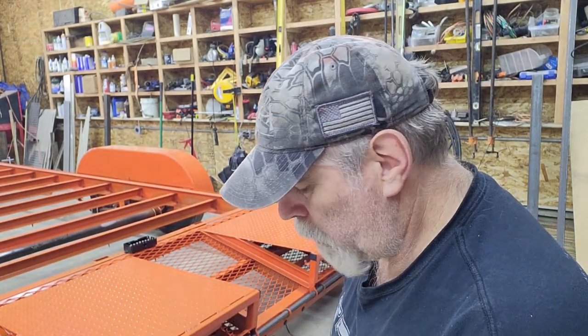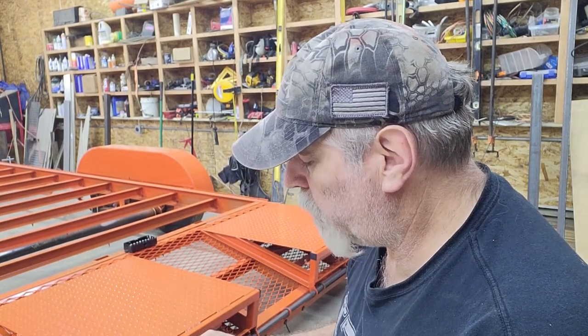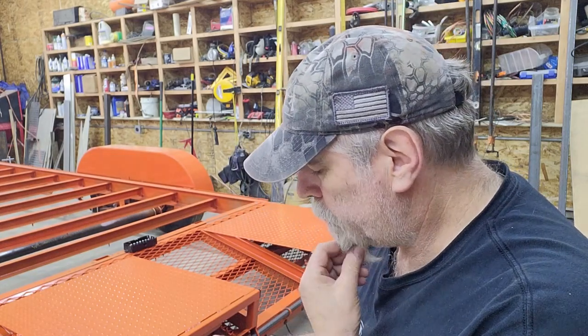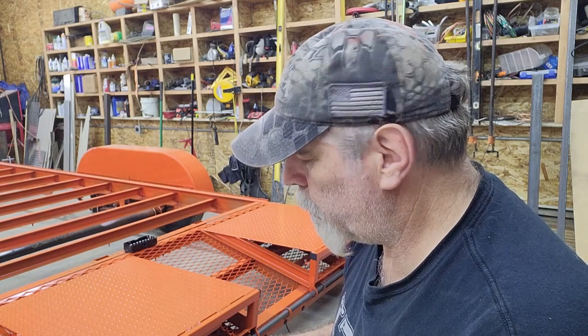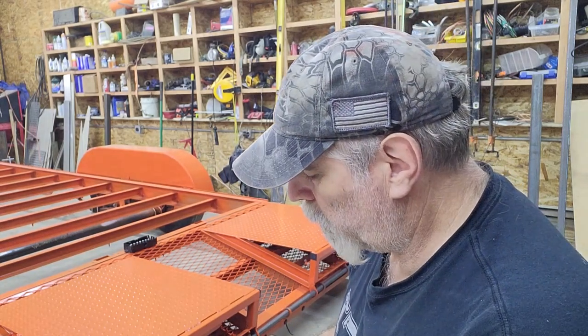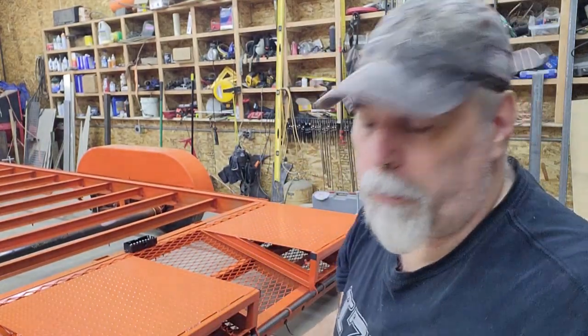So at any rate, for this trailer, it's going to be the traditional white ground, brown tail marker, yellow left turn, green right turn, blue brakes, and then because the black is a much heavier gauge wire in this to handle the extra amperage of charging the battery, for my case here, the black will be the 12-volt charging, and the red, frankly, will be a spare because I won't use it. So I'll keep laying things out here and then bring it back in a second.